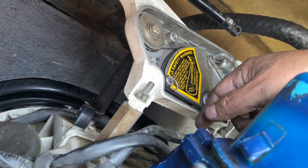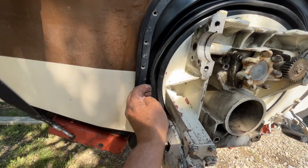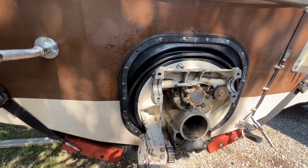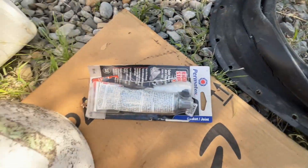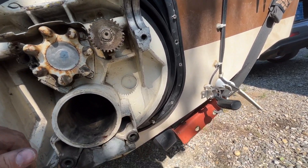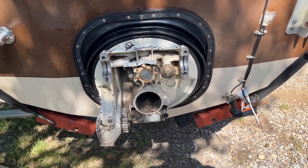Lesson learned: the trim should be adjusted to about the middle. The rubber still pulls quite a bit, but I have the screws just started and now all the holes line up, so that was a smart thing to do. I just used a small amount of - it's upside down - but that's the 'Right Stuff' gasket maker, it's silicone RTV. The rubber will make the contact, but the silicone just makes sure it doesn't leak. There's just a small amount and I put it in every screw hole. This one here was a little bit loose - I'll verify those after, but right now we're ready to put the leg back on.